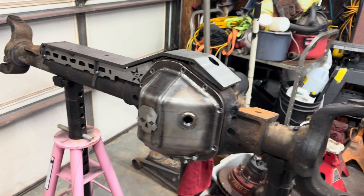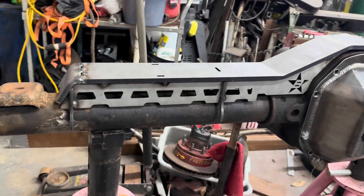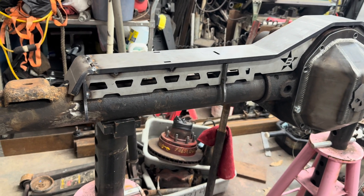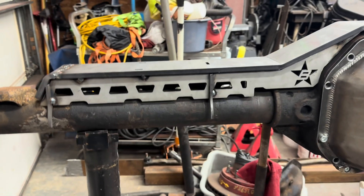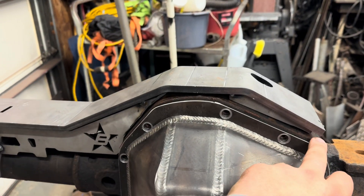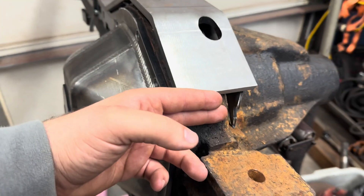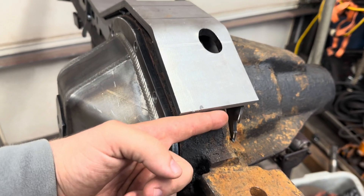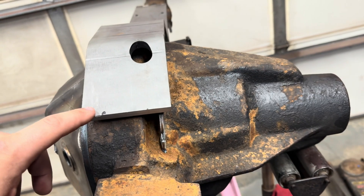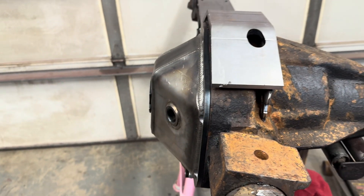So it's Saturday, back out here in the garage working on the truss. Over here I'm pretty much happy with how things are lining up. There are some gaps, but everything should be able to be filled with weld. I trimmed up a piece and put that in. What I'm about to do is make a little cardboard template — I want a piece that drops down here and then a larger one that goes down to the bottom, all made out of quarter-inch plate. Pretty beefy stuff.